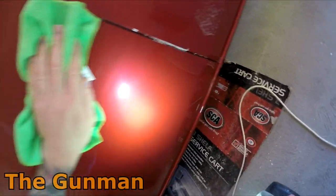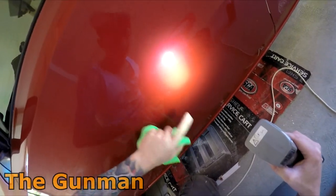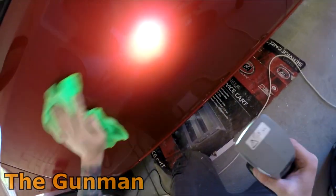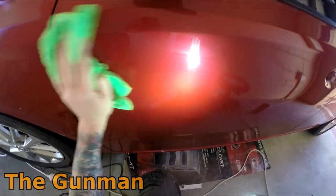Still a little bit scratchy down here, but honestly, something that I can probably live with. You know, I might just give that a little bit more buff. The HS clears usually are a lot harder to buff than your MS clears. So just keep that in mind.